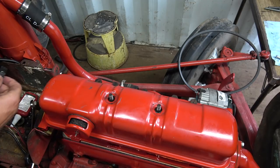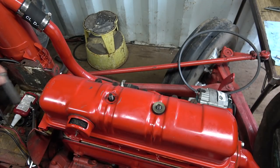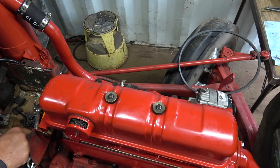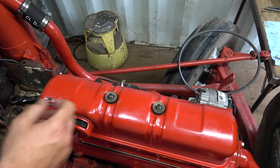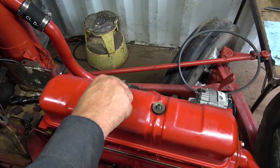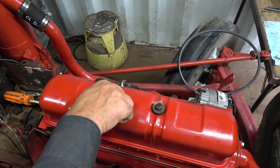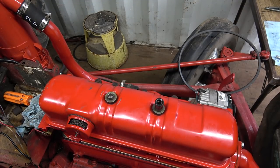So now, got these washer gasket things that we should have another one. And there actually is a torque value for these things too, surprisingly enough. And what nuts are in here? Got a whole bunch of nuts here. Not that much. Fine thread nuts. I don't think there's any washers on them. Okay, I will look up the spec for torquing those down because I don't know. Okay, so 120 inch pounds.